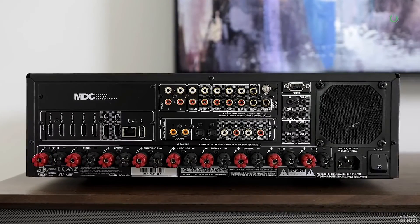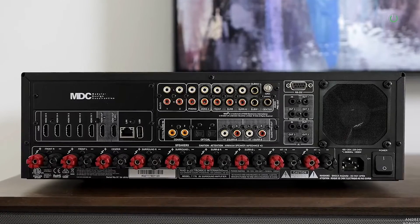By doing this, you will have your Dolby Atmos content and at the same time your 4K resolution on the screen, provided your content is in 4K format. For those who have an AV receiver, the ideal job of an AV receiver is to act like a console in your home theater system — you connect multiple HDMI inputs and pull out a video output to your projector. If your AV receiver is Dolby Atmos enabled and you have dedicated Dolby Atmos 7.1, 9.1, or 11-channel speakers, you will get Dolby Atmos sound, and the video — Full HD or 4K depending on the input — will go to the projector. Expecting the projector itself to have HDMI ARC will be really difficult, as most projectors today do not have that feature.